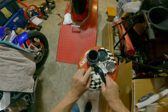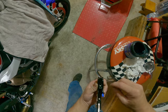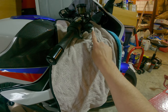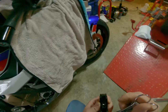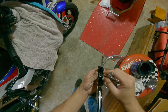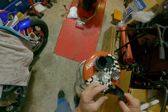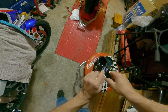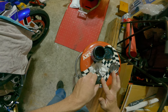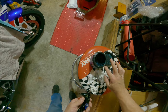I lubed the whole collar on the sides, moving up the top and over here. Now inside the lever there's that little silver part — you have to find the notch, basically a little hole — because that little rod thing that sticks out to activate the brake light has to go into this hole. So you're going to have to move this thing over just a little bit. Make sure you lube the top part and the bottom part of the collar. There is a spring in here to make the lever pull up when you adjust it.